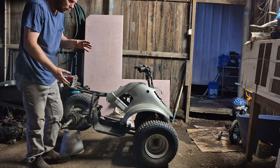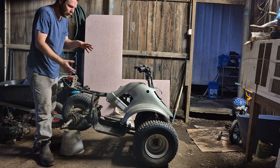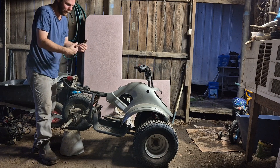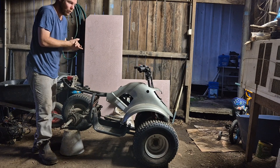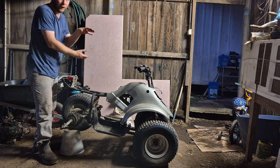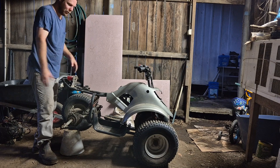I've just got to make a really sturdy housing for the battery, which I'll show you a video or some photos of shortly. I was going to make a really sturdy housing because obviously if a stick or something comes up underneath, we don't want to pierce a lithium battery. It's a 48 volt lithium battery, about three kilowatt hours, so there are quite a lot of cells in it — it's not a small battery. Completely assembled including its BMS, the battery weighs about 20 kilos, so I need to make sure it's safe.